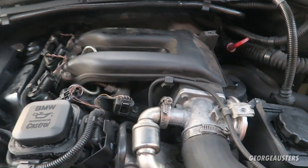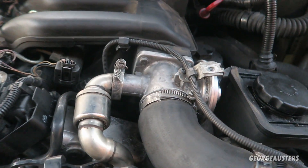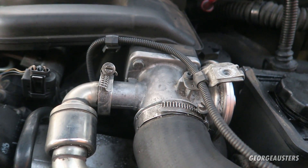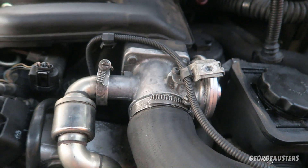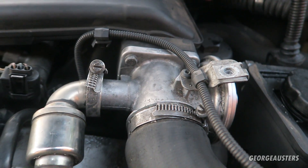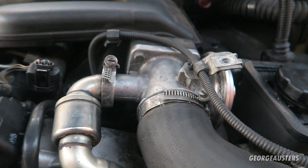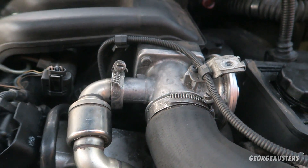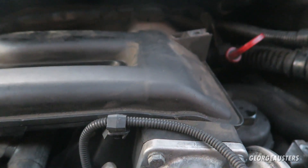That brings me on to the EGR. I would only recommend cleaning out your intake manifold if you also go ahead and remove your EGR valve. Your EGR valve is pretty much going to be completely clogged up by 100,000 miles if it has not been cleaned. You have the option of blanking it — fitting a straight pipe and blanking off the cooler section — or you can just keep on top of things and periodically clean it. I would recommend cleaning the EGR valve every 30,000 to 40,000 miles, just to ensure the valve is not getting stuck in the open or closed position. If it gets stuck open and you're only letting hot exhaust gases through all the time, there's a chance you can burn a hole in your intake manifold.